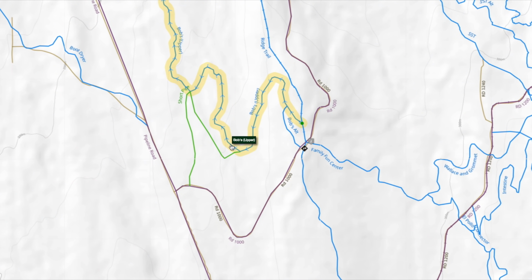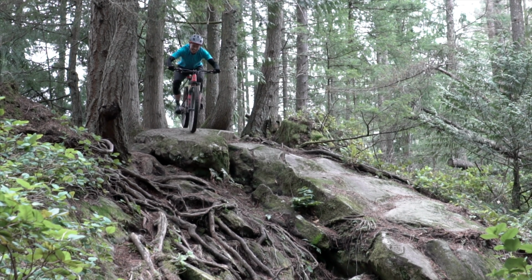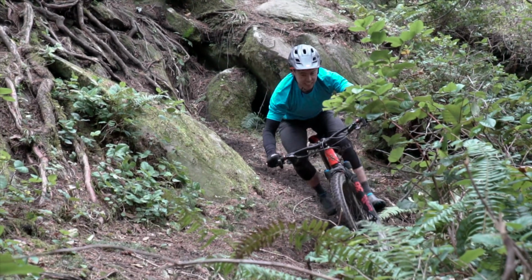Once you have a baseline on the low speed rebound, let's try and get into the low speed compression. A lot of this is done through feel, which is why I think it's really important to set up a circuit that you can ride multiple times in a row. For instance, I would find something that hopefully has at least 20 seconds of descending and that's easily able to be repeated. So it's got like a climbing trail nearby, or you simply don't mind hiking back up it to ride back down again. You might notice that without much low speed, your suspension can start to bob.